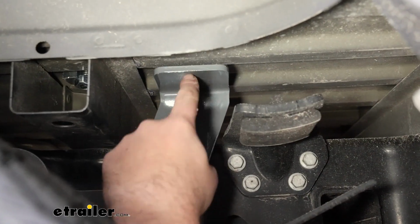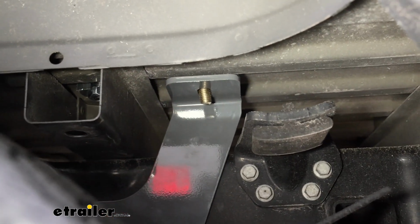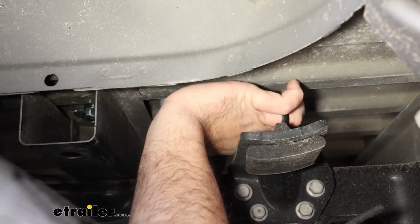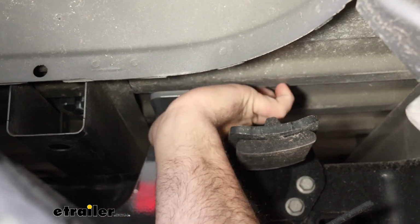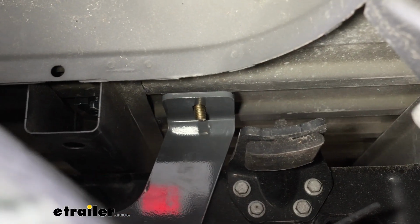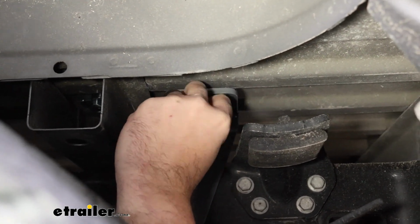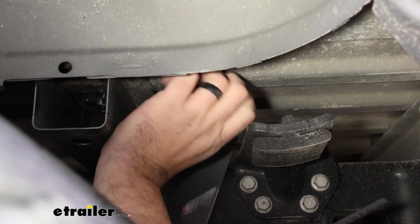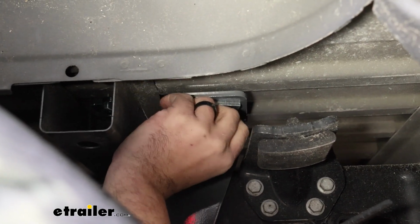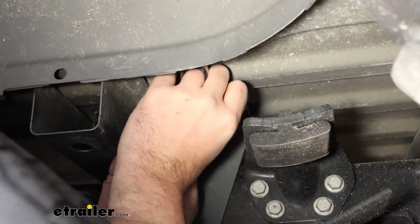Now, the rear bolts are going to be a little bit different just because we have that corrugation going up. So we'll take the U-shaped spacer and make sure that you put the tape on there facing the bed. That'll slide in place. And again, this is just so when we tighten it all down, it's not crushing that down. Once you get the U-shaped spacer in place, it's going to be similar. The rectangle spacer doesn't need to be taped because that's going to be resting against the B&W portion. So same thing, flat washer, split washer, and nut.